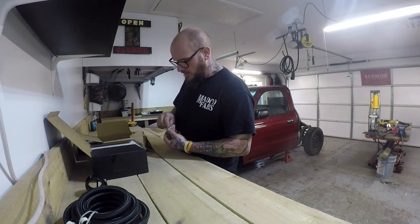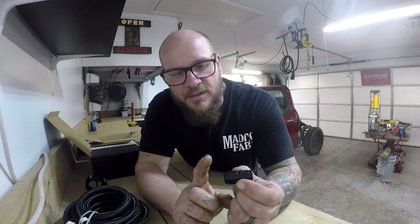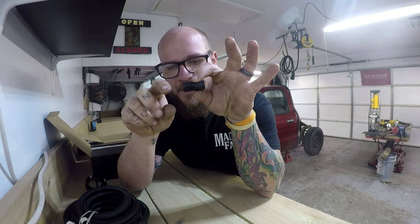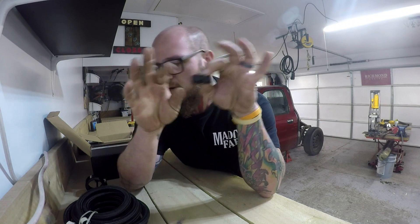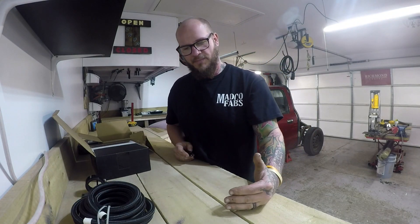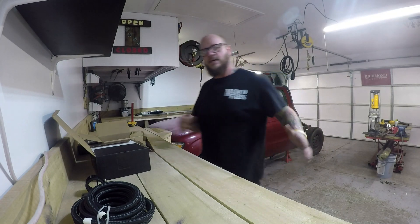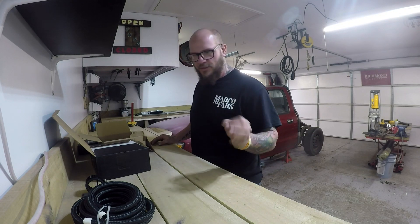They're just 90s and couplers. I do want to show you this right here — this is sick. This is a 6AN female and a 6AN female on the other side, so I can take two and connect them. On my fuel pump I did a six out, and on my fuel filter I did a six out. That way I can just screw these two together and I won't have any AN fuel line in between. So if I need to pull my pre-filter, my fuel pump, and my post-filter, I can pull that whole system as one unit, kind of like a fuel rail. I'm just trying to make ease of work for power tours and things like that. Guys, it is a drift truck, and it's kind of changed a little bit since I started.